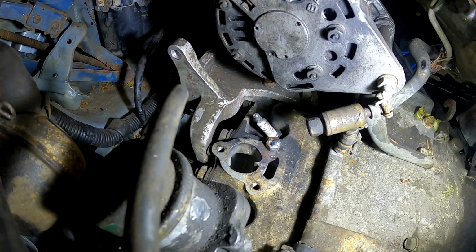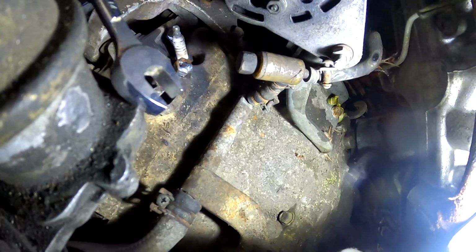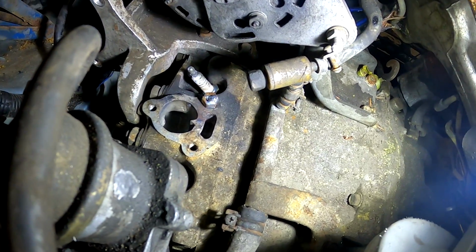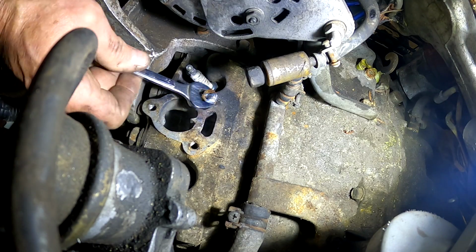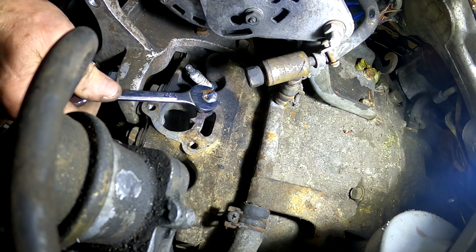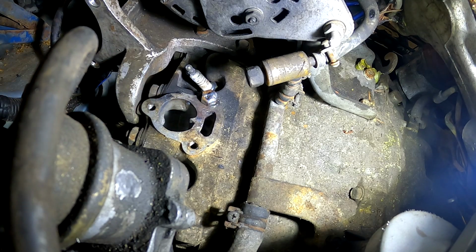Well, this one's in a much tighter spot because the alternators are kind of in the way, and this doohickey gizmo thingamajig right here is in the way. The camera's falling down, and everything's just wonderful. So, what I did was weld a nut. There was enough of it sticking up I could get a pretty good weld on it. And I'm just going to keep working that. I'm going to squirt a little slickum goodie down in there and see if she'll penetrate a little bit of oil in there.